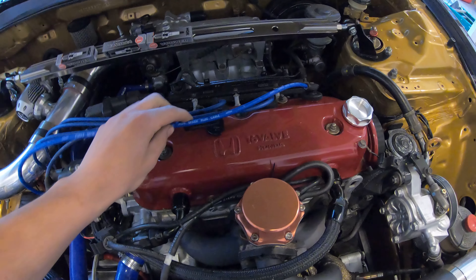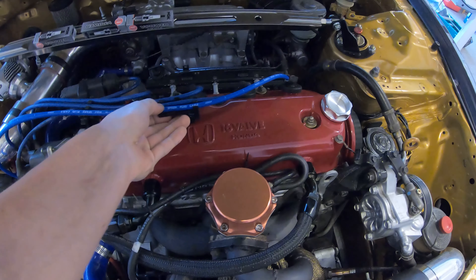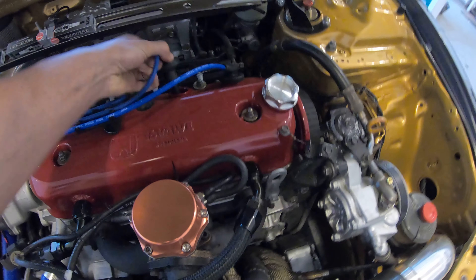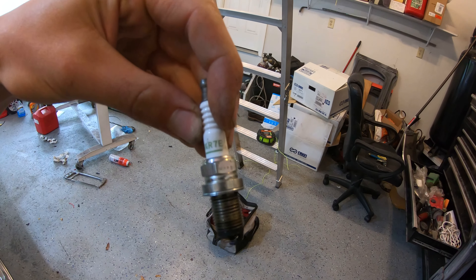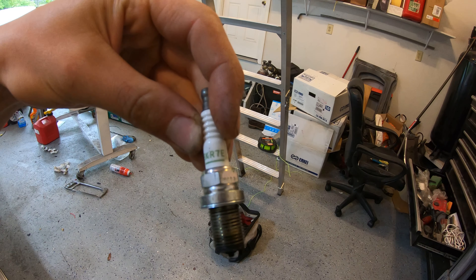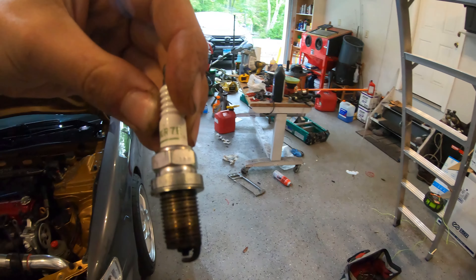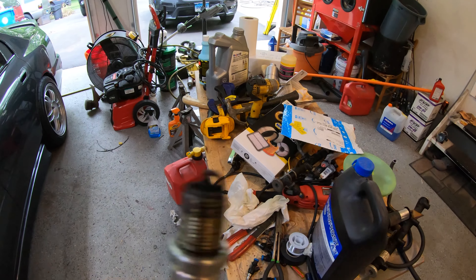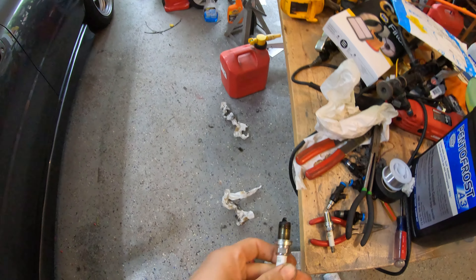You can only put them on and off so many times before that's it for them. I'm going to put these on one at a time and put new plugs in as well. I run NGK plugs — the NGK BKR 7E. I go one heat range colder than the stock plug; stock plugs are a six on most NA motors, so you go to a seven which is one heat range colder for a turbo car. Here's the old one — you can see it's pretty black and pretty toasted.